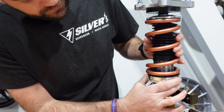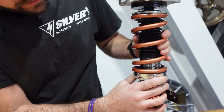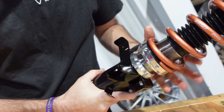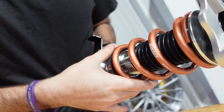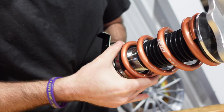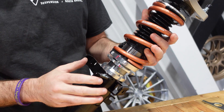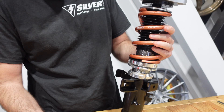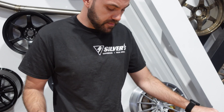So if we're starting out from zero, we've got our up-and-down play. Bring this around — no more play in it. Get a good visual on that collar on your mark. You're going to spin that around two complete rotations. So that'll leave us with four millimeters of preload. If you want five millimeters, that'd be two and a half rotations. If you want three millimeters, that'd be one and a half. Simple as that — snug it up and you're done. Locked in.